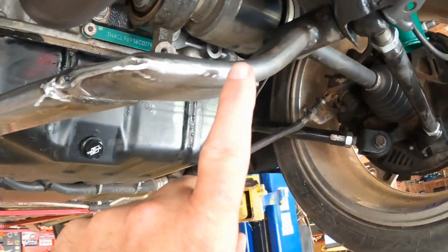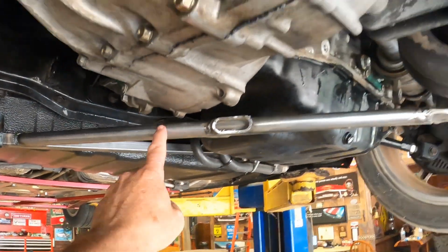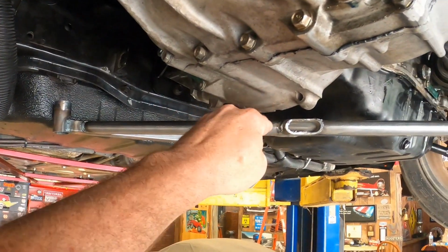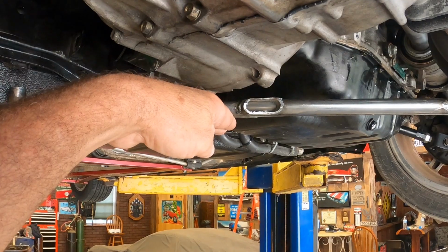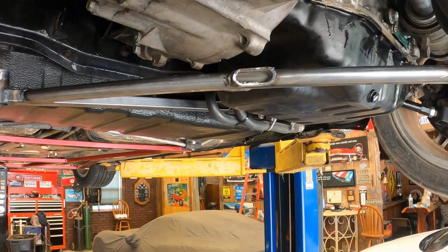And as you can see, when he bends the tubes in his bender, when Boris does it, it collapses them anyhow. So what Boris is going to have to do is figure out the difference between both ends of this bar and the middle, which is going to come down. So he's got to figure out the height difference between the flat bar and where I'm going to put it. And then he's got to put a slight bend in the new tube, just to clear the transmission bell housing.